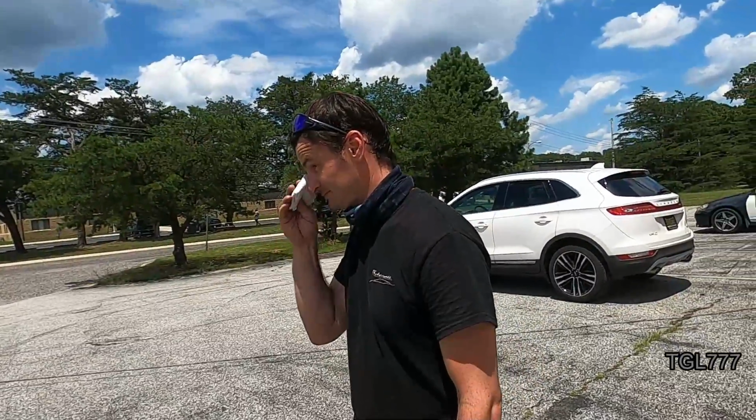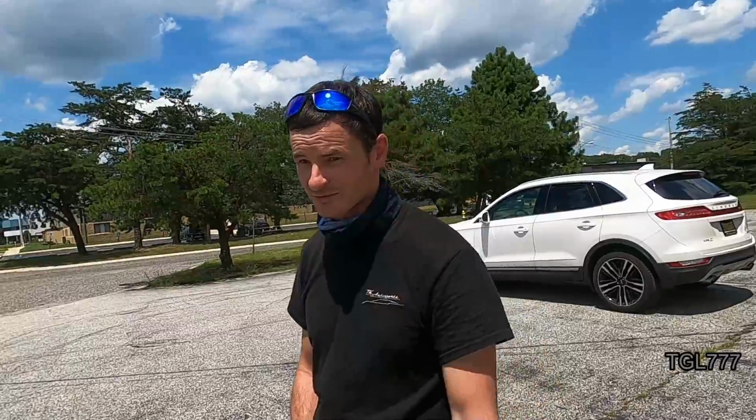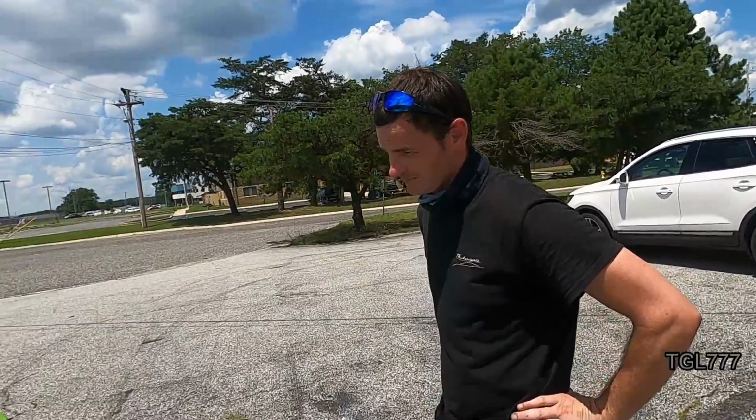I remember when I had my car, some of the Z06s had some issue with the heads. The engine. This has all been addressed on this one, correct? Yep, this one's been fixed. They had valve seal issues, and because they can rev out to 7,000, a little bit over, they have valve spring issues, that kind of stuff. So this motor wasn't directly from GM Performance. This was a GM Performance crate that they then put the better valve seals and valve springs and all that into.